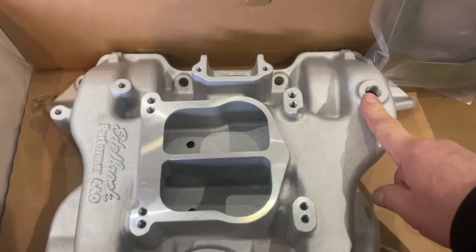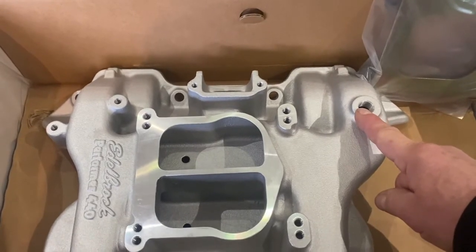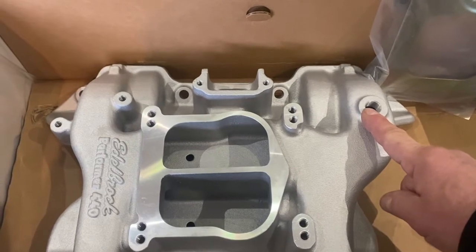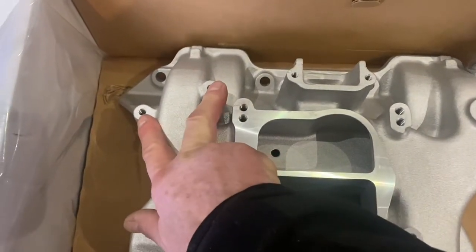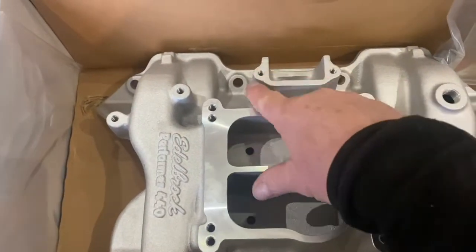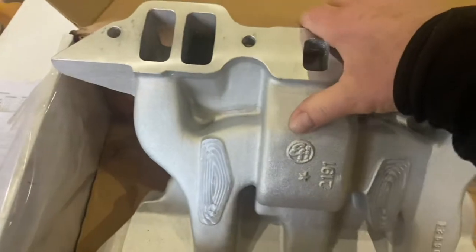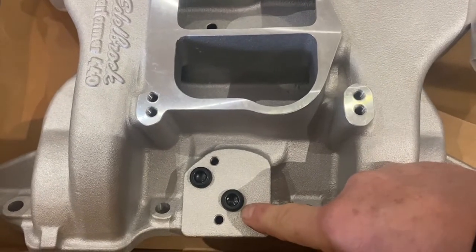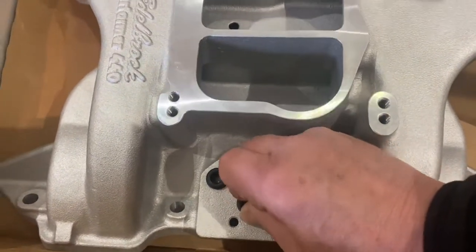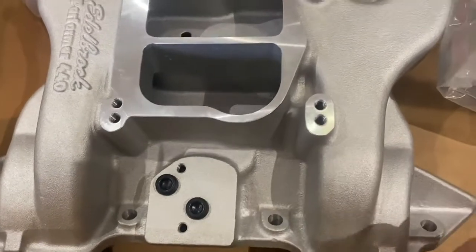That's where the pipe goes that you connect to the brake servo and other vacuum accessories, applying the main vacuum over the system. That's where the coil would go. I have absolutely no idea what goes here — I haven't got anything on that in the car. The manifold female part is tapered, so these get tighter as you twist them in. Just put some sealant on there and screw them down until they're tight.